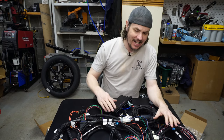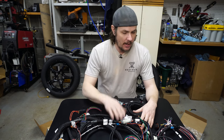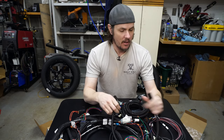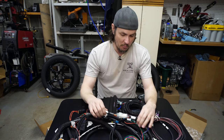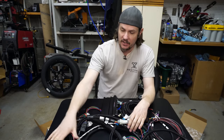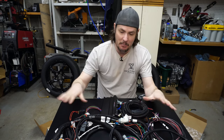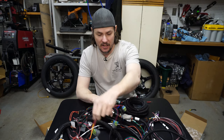Pretty nice package. It was about $900 for the LS1/LS6 package without the display, plus another $40 in auxiliary harnesses. The whole purpose of doing these jumper harnesses is so I do not have to hack up the factory harness or Holley's harness — I want to keep everything intact for whenever we do an engine swap, maybe an LS swap. A lot of these adapter harnesses will carry over.